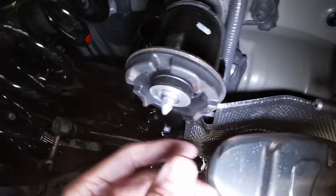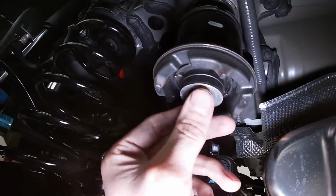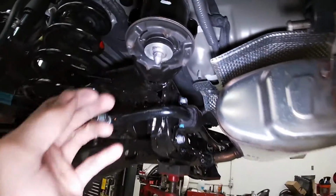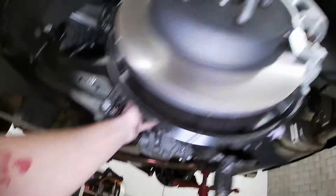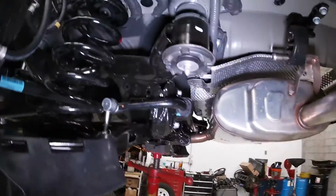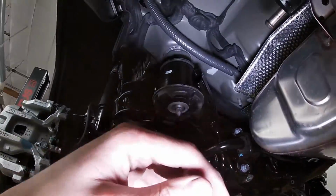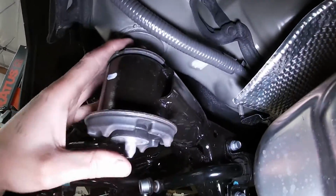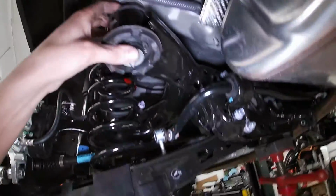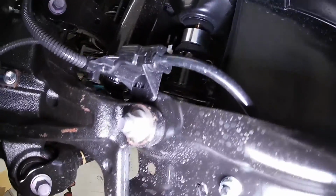So for the rear setup, which is a stud, there's a 10mm hex on this where we can pull this stud out of the body, and it will be replaced with a bolt setup like the front. You want to have the fronts in already so everything is lined up. Otherwise the whole subframe could move around a little bit, be a whole lot of hell for you. So we're going to pull these studs out, lower the subframe a tiny bit more on this side at least, get the spacers in there, do the new bolts and washers and everything. And then once we are done with that, we'll get these mostly snugged up, not totally tight.